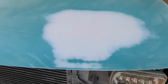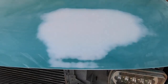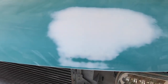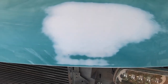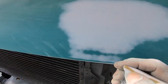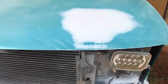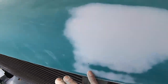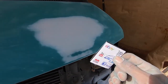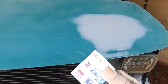We're putting a single stage thick enamel on it, so I'm not going to worry about every tiny pinhole — it will cover and it won't be a problem. But remember: the technically correct way is to hit it with a sealer — a 1K sealer or a little bit of primer after — because you're really not supposed to paint over glaze putty. However, this is a gray putty color and the paint is going to be white, so it won't show. In the old days, red putty could sometimes bleed through to white. I don't have a good spreader so I'm just using a bent card — you can get creative.